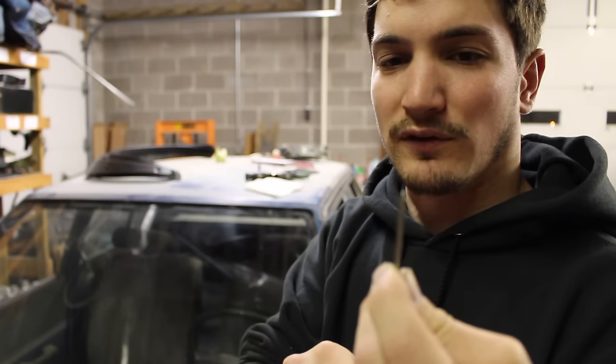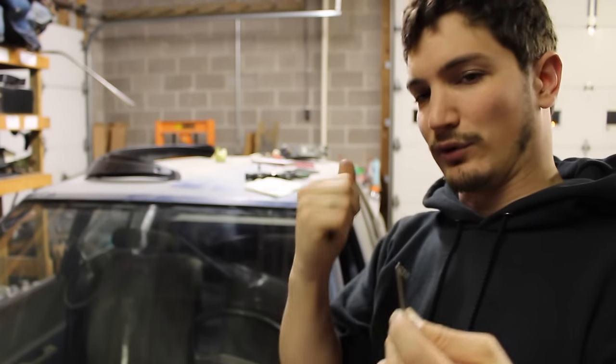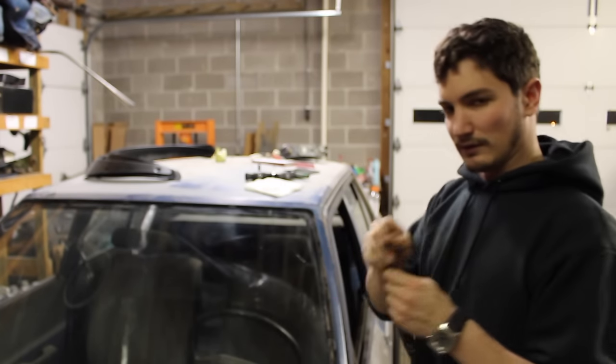About a quarter of an inch folded over, and then we're going to push that through the urethane. I went ahead and poked the T-handle probe through first to make a hole, and then I'm going to go back in with the cable. I kind of opened the hole up a little bit without cracking the glass.